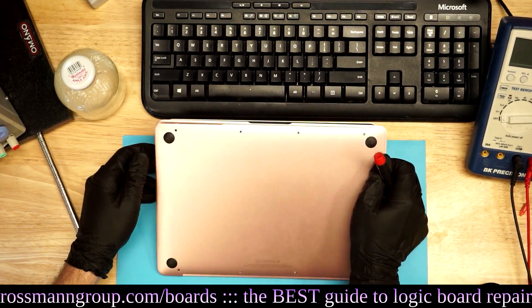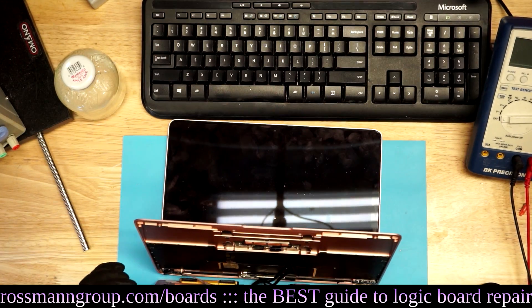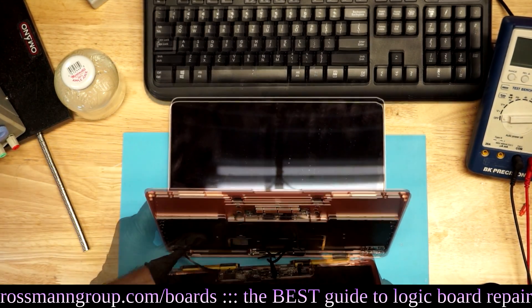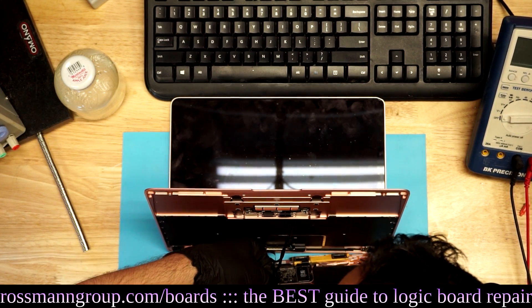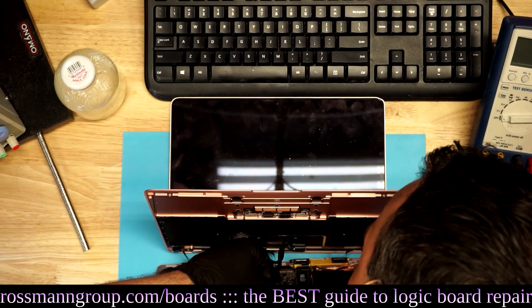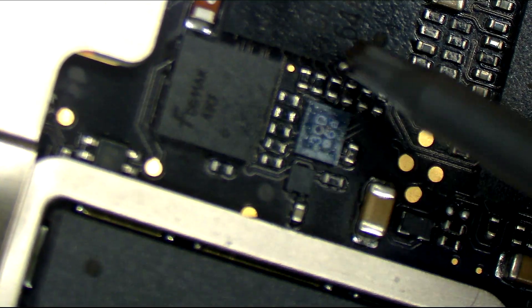You got to be careful. First you got to open it up like this, then open up the bottom very carefully because this little cable is a trap laid by Apple. If you do not disconnect this cable while the machine is half open — if you wait to open the machine entirely before unplugging things — you will rip the cable. This is indeed the 2016 model. You can tell by the USB-C IC over here, the CD3215. This is in the 2016 model, not the 2015 model.